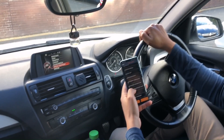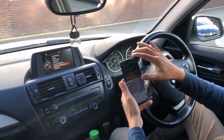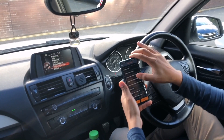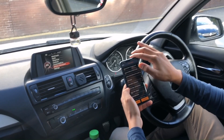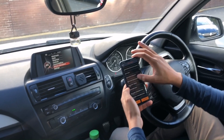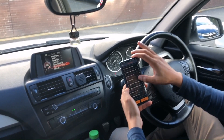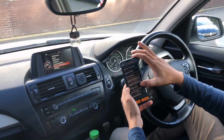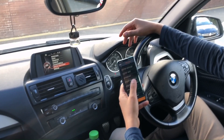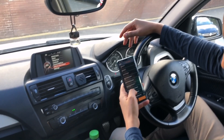That first coding is finished, so let's try the welcome light. At the moment the welcome light is off — we're turning it on. Welcome light when dark: no, we want it on in daylight as well. Welcome light brightness: very high. Welcome light standing light: left. Now we've done that coding for the welcome light, we'll see what other coding we can do.